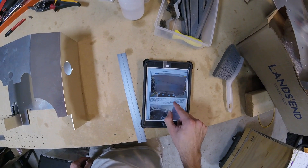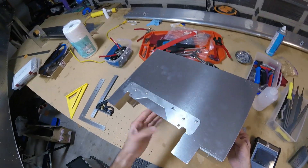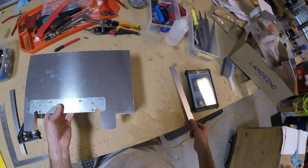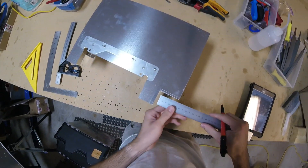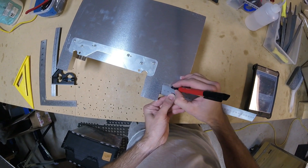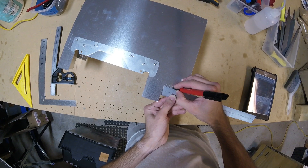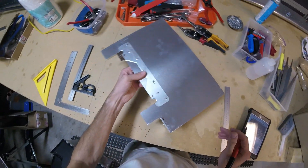So they're saying to position it — I'm pretty sure you can do everything you need before this thing even gets on the engine. We're going to go 23 millimeters — right about there. That's very specific. And then 120 millimeters up from the step. I'm going to get my square and use my metric ruler to measure it out. So I'm right about there at 120.